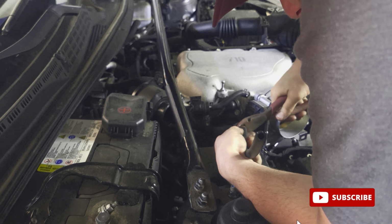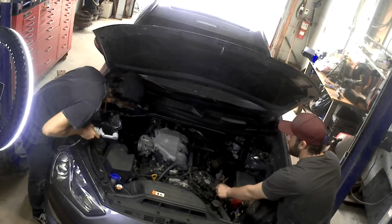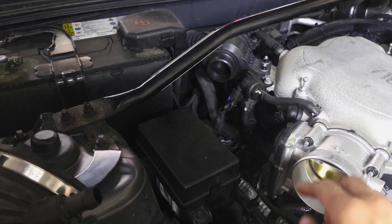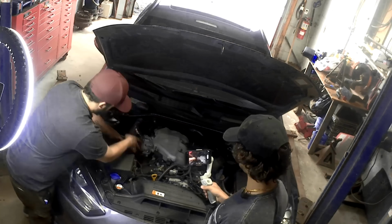So we've also gone ahead and used the same clamps that we've used off of the leaded rubber hose. We found a couple hose clamps to put on the catch can side, and after we ran the second hose and zip tied it up, all that was left to do was put it all back together. So after finalizing the placement for the catch can, we ran all the tubing behind and nicely secured it down. So off of the PCV valve runs the intake hose, and that's going to be a 3/8 hose, and that runs behind into the catch can. Then a 1/2 inch hose runs all the way back and into the intake manifold right here.